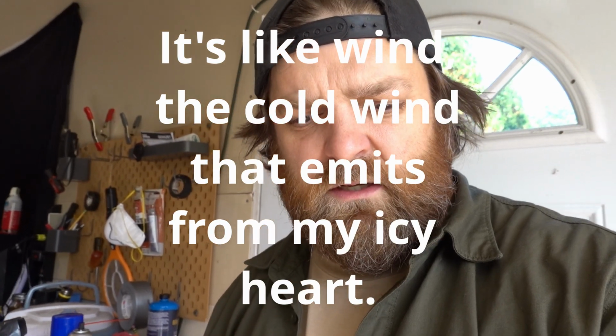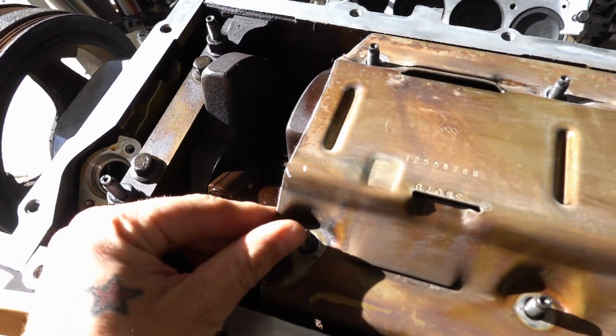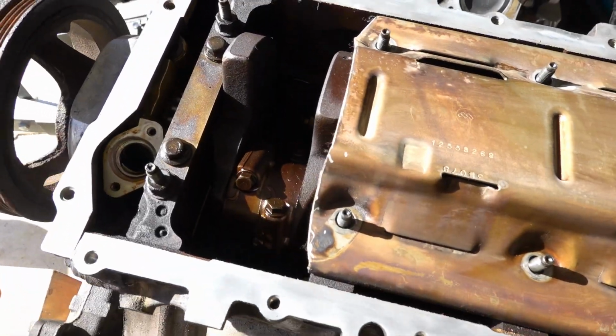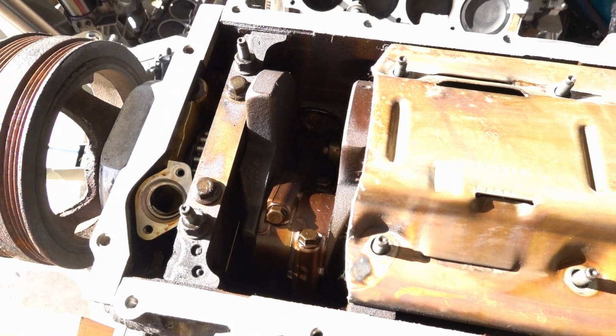When we go to change the oil pan for the F-body type or the muscle car oil pan, because the oil pan is so thin at the beginning of the engine, it hits against the windage tray. So what we have to do is mark it and then just slice it. Get some fuzz here, but basically I just took a line straight across and cut it. So now we'll get that tray to fit.